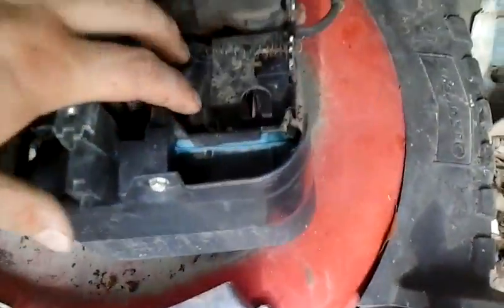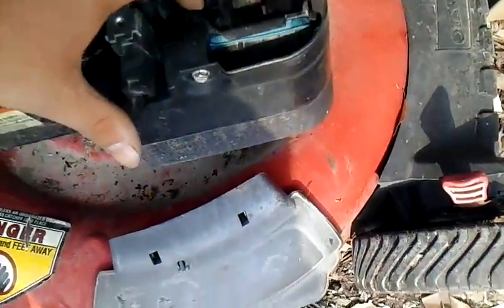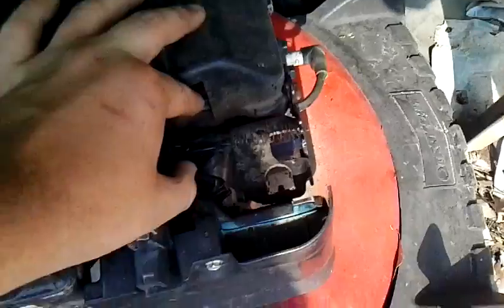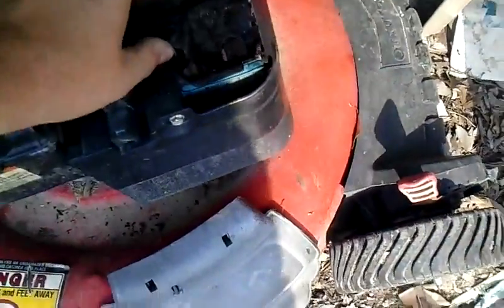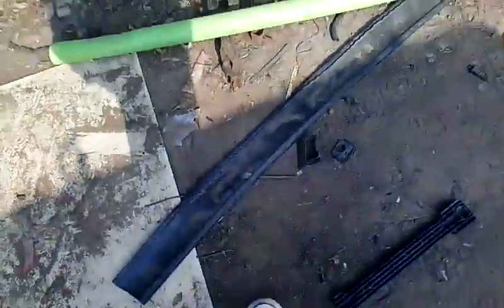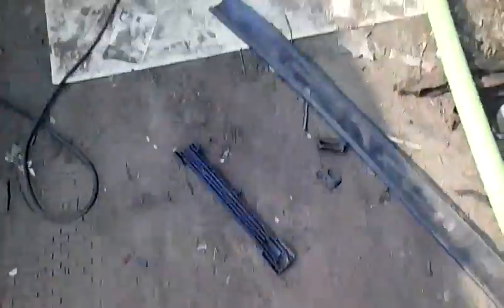I've been having trouble with this Troy-Bilt here recently. I need a choke spring for the choke — it has an automatic choke; every time you kill it, it turns the choke on again. I need a spring right there and I don't know where to get one, so you can tell me. This one just runs and quits — gotta re-clean the carburetor. It's that Pulsa-Prime carburetor; I hate those carburetors.